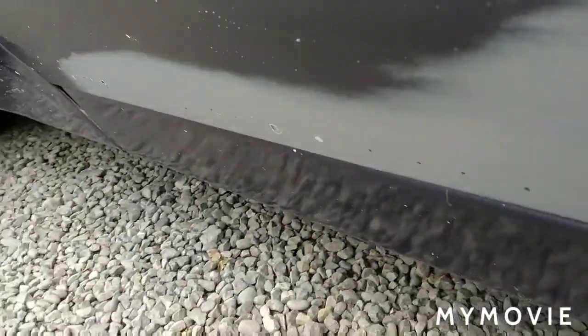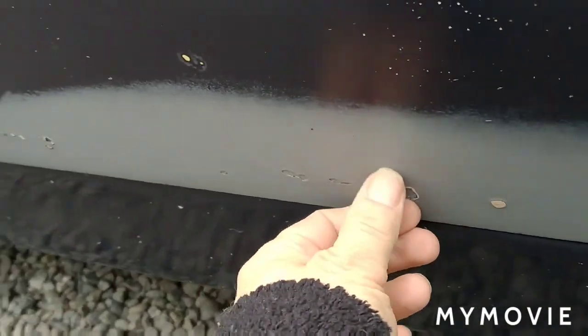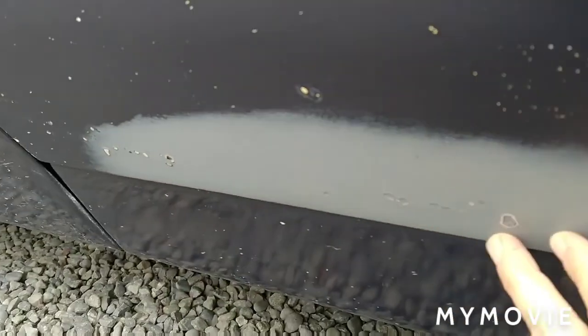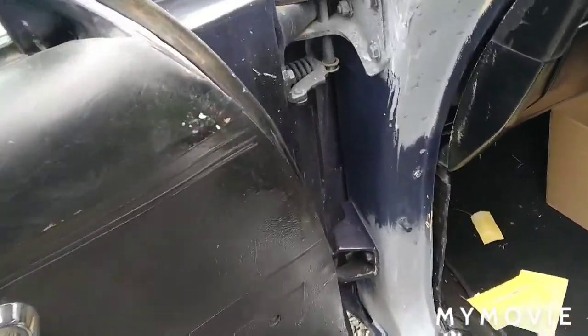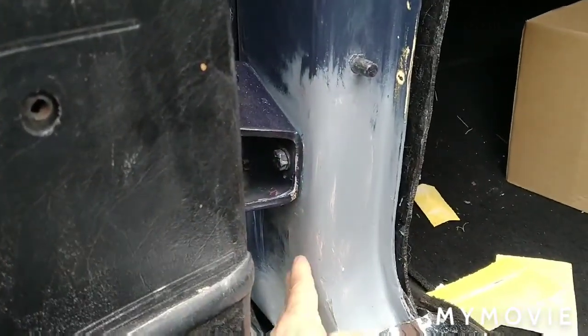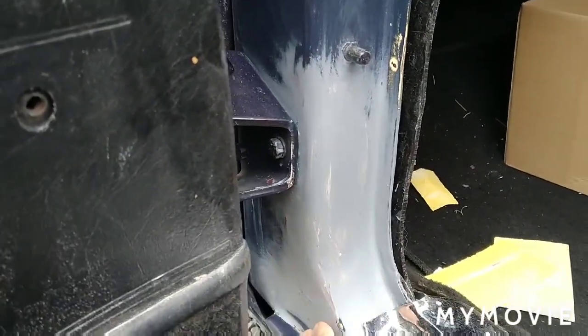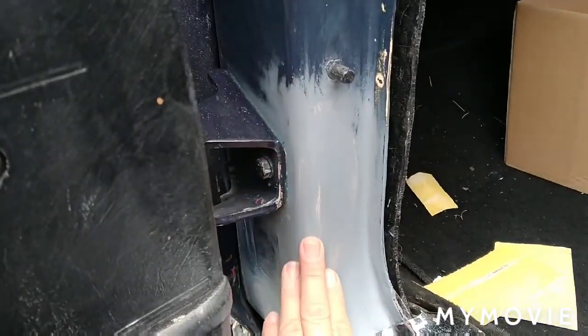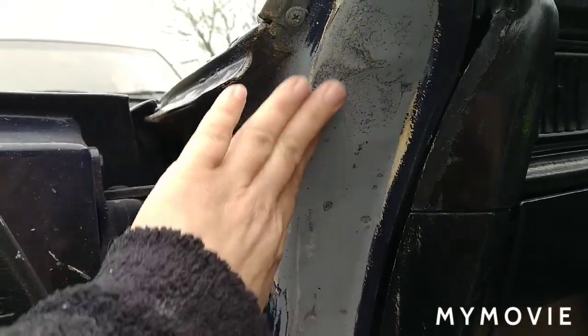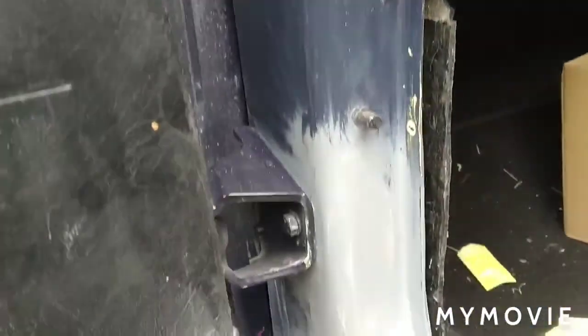And the door - those rust bubbles - they've just popped off, even all the way, so all I can do is cover it with colour, and it's just not going to look pretty. But I am a bit pleased with this coming up quite well. I had to grind down the welds a little bit and tickle it up with a little bit of bog, but essentially you couldn't tell that was there. There was also another repair up there, but I'm not going to muck around and make it all smooth and pretty - I'm just going to try and get a bit of colour on.